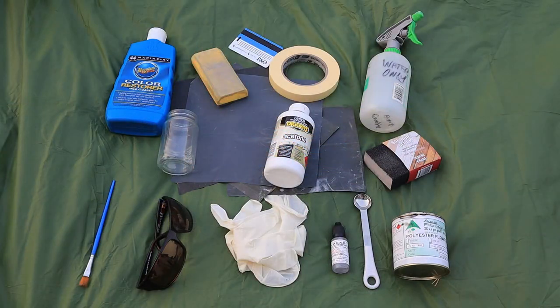When you go to your local fiberglass shop, they will be able to supply you with a small can of liquid Flowcoat resin with a pigment mixed in to match the colour of your hull. They will also supply a small dropper bottle of the catalyst to harden the resin. For polyester resin, the catalyst is called methyl ethyl ketone peroxide, commonly referred to as MEKP.